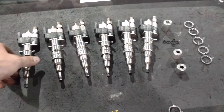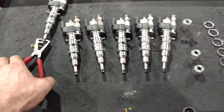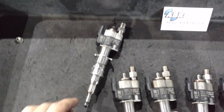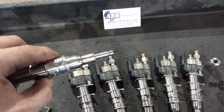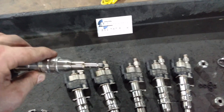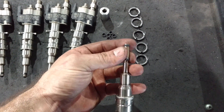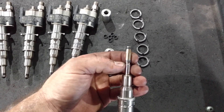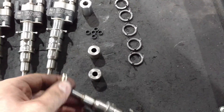The first thing we need to do is take off this ring. There's a special pair of tools you can buy — basically just cutters — you stick them on there and cut it off, and you get a ring. That ring is where the new injector is going to sit. Now, there's a little adapter — it's like a cup — and it sits on here. What it does is it slightly expands that Teflon ring so you can push it down onto the injector. And now that has been pushed on.